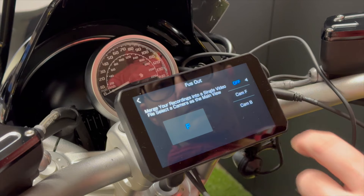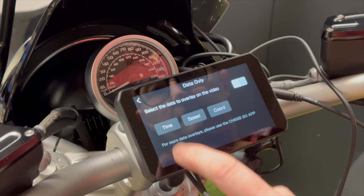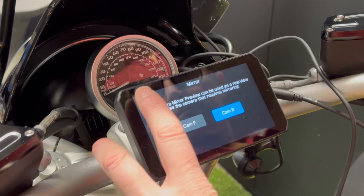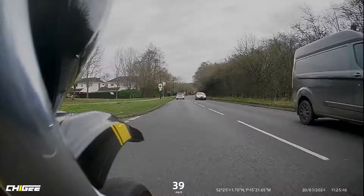You've got the front dashcam, the rear dashcam, the GPS, and then the power and switch live. Tip: test the machine before you put it on — just twist the switch live and the live together as one wire and attach that to the positive; you'll then be able to test it as if it were all switched. I've actually left mine permanently twisted together because I've wired it into the GPS connection for the sat-nav on my R90, which means I don't have to worry about finding the switch live. It does mean I lose the functionality of it recording if someone knocks the bike when it's stationary, but I've got the positive side stopping my Nova Zero draining the battery when I'm not using it.